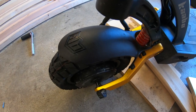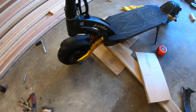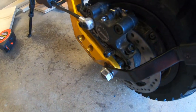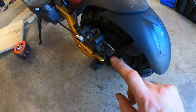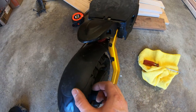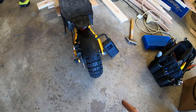The front fender with the KB goes in the front and replaces your stock fender entirely. The rear fender goes in between your axle nuts there, in between the frame — that makes it really hard to tighten the nuts without the bar moving, so I'm going to put some red Loctite on these for sure. The stock fender was already on there, and then this aftermarket fender slides underneath it and is held on with these two stands.